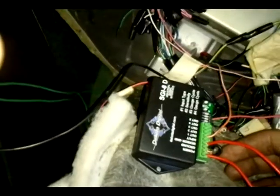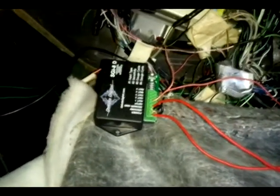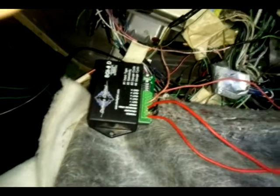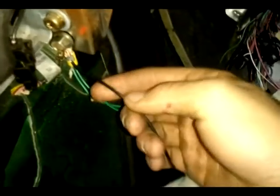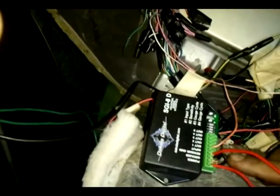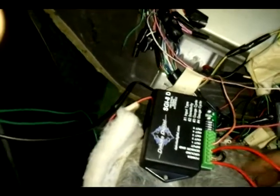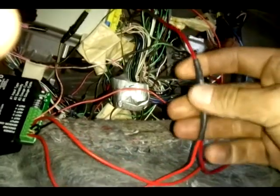The ground down here — it says ground and sensor ground. All my sensors are actually grounded right here to the chassis, because I didn't see a point in running them all over to the stock location. I jumped the system ground and the sensor ground together, and the power I jumped right off of my ECM control module main.